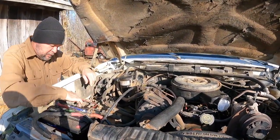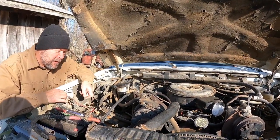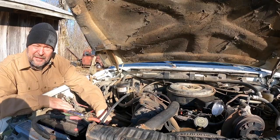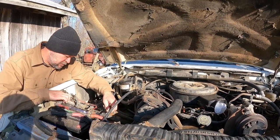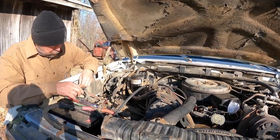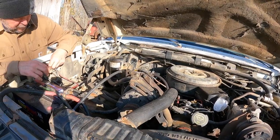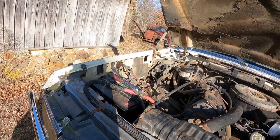The clutch pedal is extremely sloppy. The bushing for the master is broken, and I wonder if it's not pushing the master pushrod enough to engage the clutch safety switch. That could be. I wonder what this is. That is why I deleted it on my truck. I wonder what this is. Oh, that would help. See if that helps. The solenoid out.